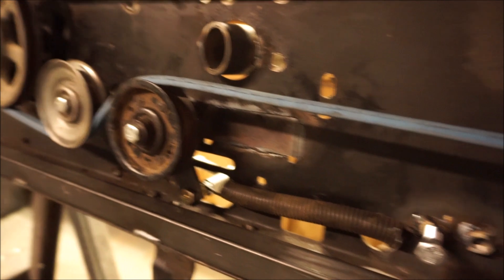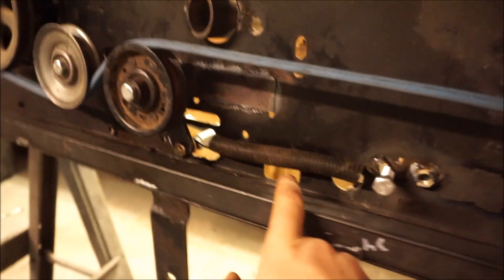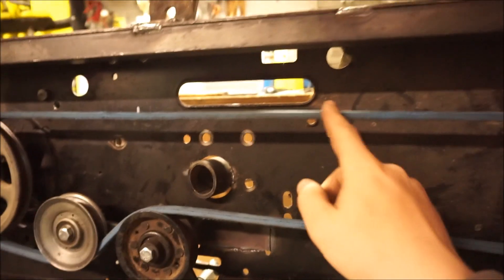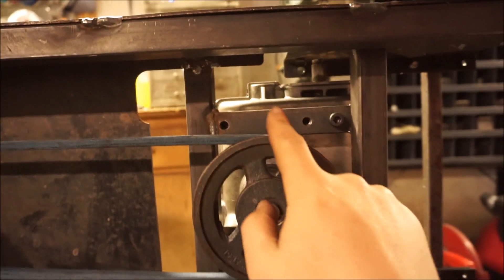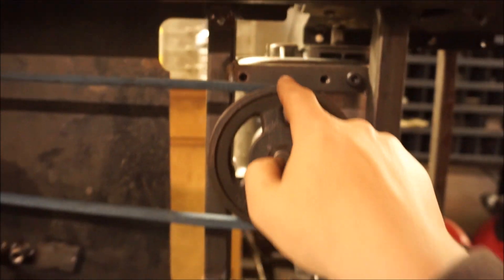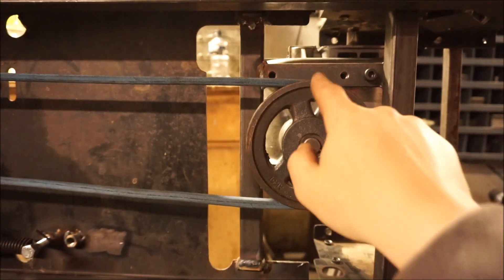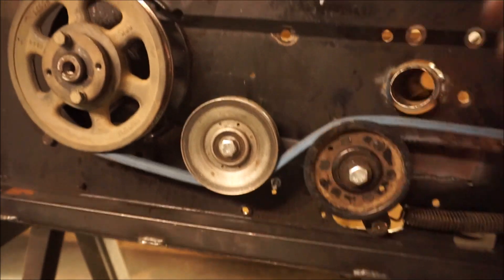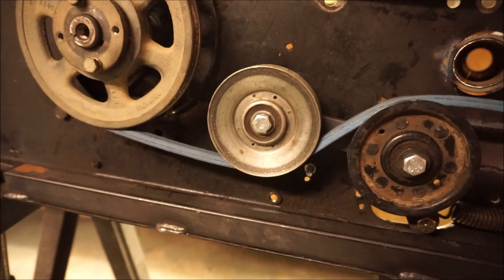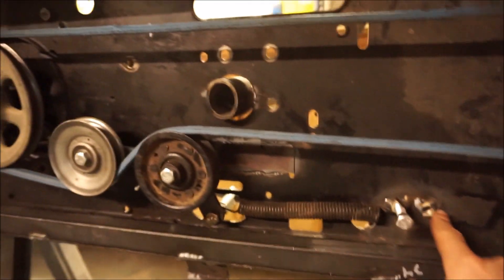Another part I scavenged off those Craftsman lawnmowers is this spring — it's a stock spring. I've got about six of them, so might as well use it. I welded a couple of different nuts here so that gives me a little bit of adjustment if it's not taut enough. I think it'll work. One more thing before I flip the motor up: I don't have my belt guards in yet — I'll put them in next video. You want probably one on either side of your drive pulley and your transmission pulley, and also one here. The one on the clutch pulley that moves, you'll want a guide that follows that pulley rather than a stationary one. When setting up the other guides, I'll do something similar — just weld a nut so I can throw bolts in to set up the belt guides.